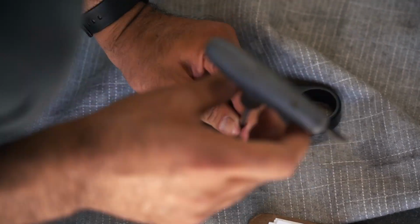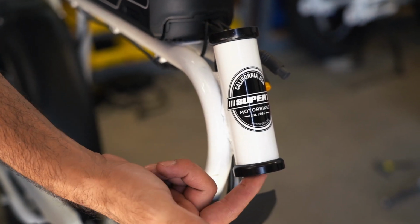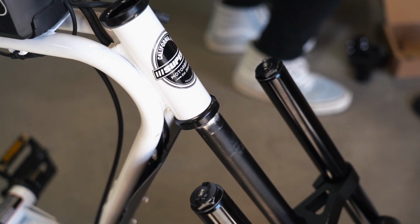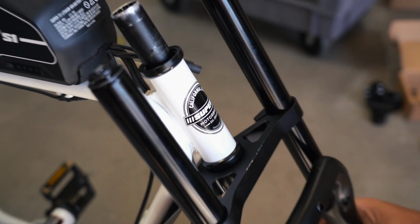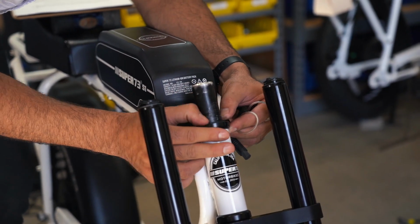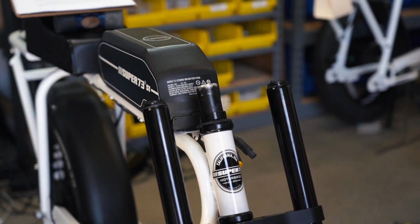With the crown set aside from the assembly, remove the handlebar clamp using a 5mm Allen wrench in preparation for the handlebar installation. Make sure the bearing set installed on the head tube is intact and properly seated. Insert the fork onto your SUPER73 by placing the steer tube into your frame's head tube. One person should hold the fork into place while the other inserts the steer tube spacers in the following order: plastic split washer with the skinny edge facing down, metal shim if applicable, dust seal with rubber gasket, and then a 10mm spacer.